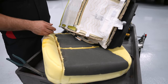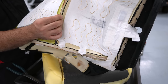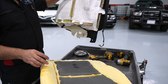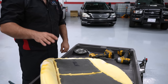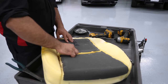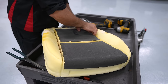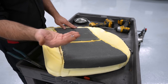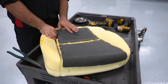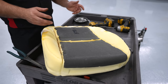Here is the old seat cover. Notice these discolorations — these are actually from the seat heater kind of heating things up; this is how it looks. We do have a lot of cleanup to do here because there are hog rings all over the place. There are all these remnants of hog rings — we've got to spend a lot of time cleaning all these out, every last one of them. Because if you leave one, it's eventually going to pinch the seat and make a hole, and then we have problems.